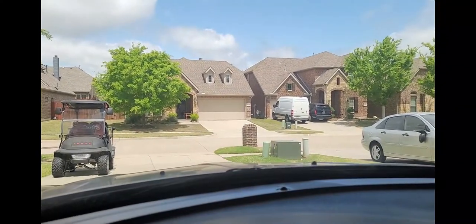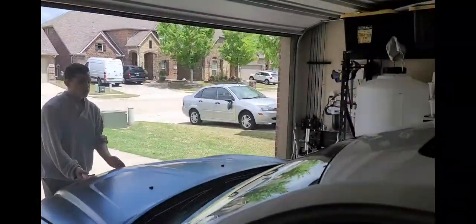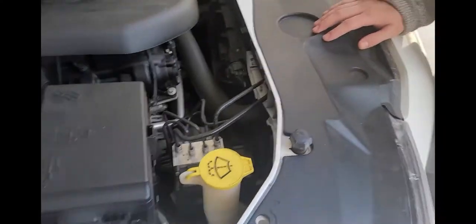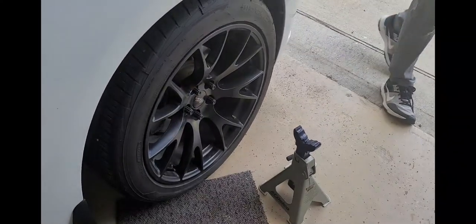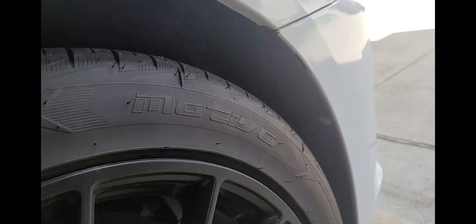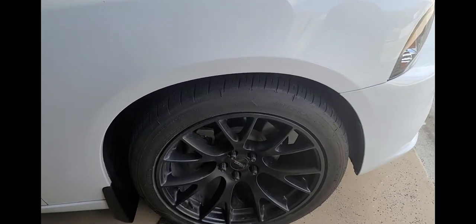What I'm going to do is — I bought the motor for the windshield wiper fluid. You probably can't see it, but it's all the way down there. The only way to get to it is to take the wheel off, take the molding cover off, and we're going to attack it through there. So the first thing we're going to do is take the wheel off, jack it up, put it on jack stands, and work on pulling it out.